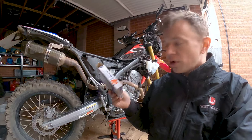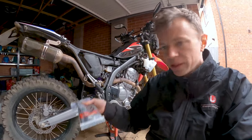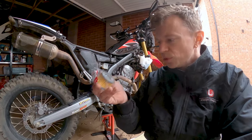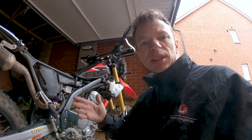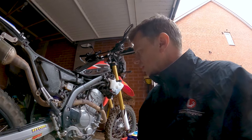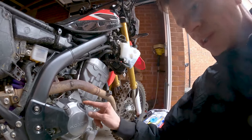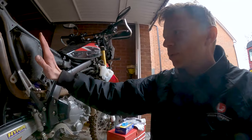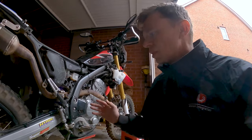I'm going to fit new clutch discs from a CBR 250/300 — I'll put all the details in the description below. I'm also going to put heavy-duty springs in, replace the oil filter and air filter, and I've got a new gasket for the air filter. I've spared you the fairing removal — it's pretty basic, just pry gently. I've also skipped showing draining the oil or coolant, but predominantly I'll take you through the clutch upgrade as it's the biggest piece of maintenance today.